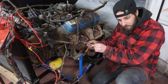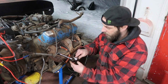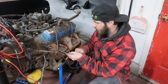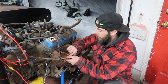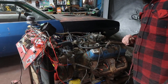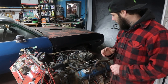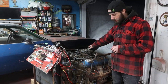I paid a thousand bucks for this motor. It was out of a 1979 Dodge Sportsman RV motorhome. I just looked at the gauge cluster — it's got like 11,000 kilometers, or maybe 111,000. Either way it's super clean, not rusted up too bad. We got spark. I'm going to leave the choke closed for now on the first startup and see if it'll fire up. If it doesn't, we'll open the choke and give it some more air. Moment of truth.